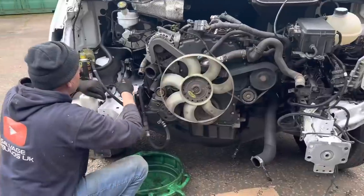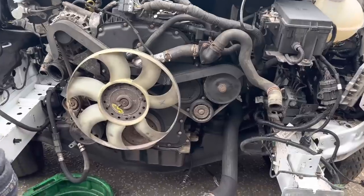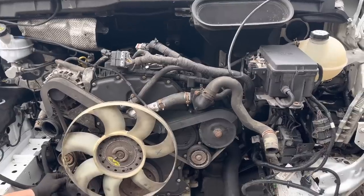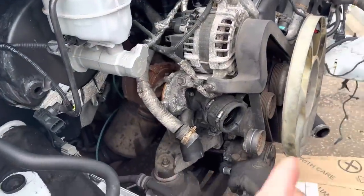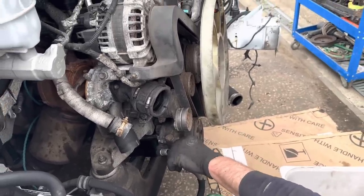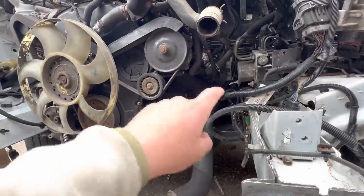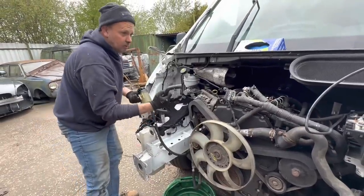Never easy, and it'd be a lie to say it's easy to put an engine in, but after a little bit of fiddling around — plop — straight in on the spline. We would have got it first attempt but I had it in neutral; of course you need it in gear to stop that spline from moving. All the bell housing bolts are back in, the cradle's back on, exhaust is all back on bolted to the turbo. Chris is putting on the power steering pipes. I'm going underneath, running all the wiring — it goes over the top and then it all starts plugging in, right over the top of the gearbox. So far so good, and it's really not taking that much time today.